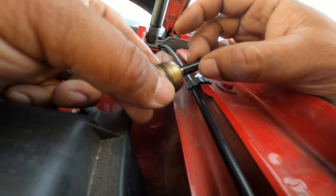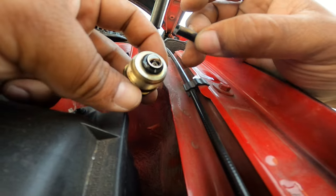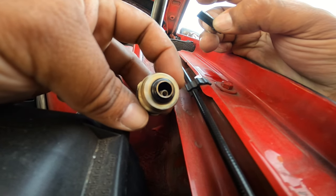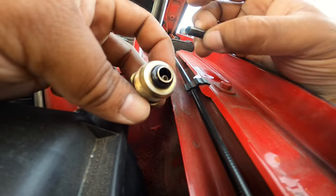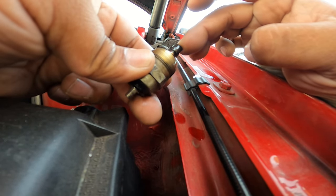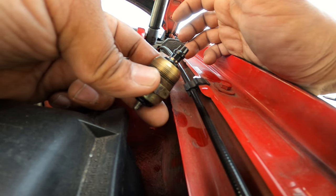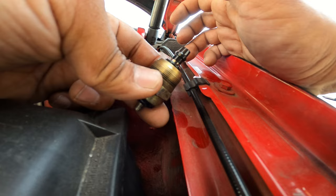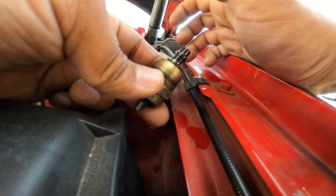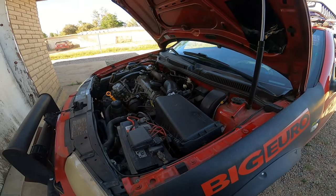You'll see there's a spring on the inside of the old part. Don't lose it — it's super important. That spring is what provides the forward and up-and-down motion on top of the electronic portion of the plunger, pushing it out. If you have any mechanical or voltage issues, it will activate the plunger and shut off your fuel. It's a very common problem with these cars.